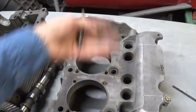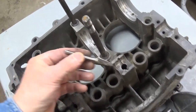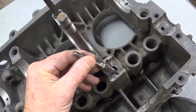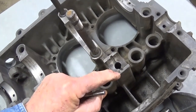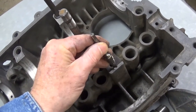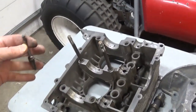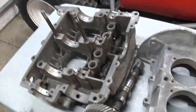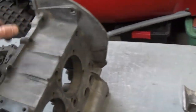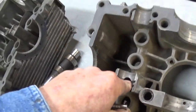As a matter of fact, if you don't drill the hole at all but you're running a bigger-than-stock oil pump with a high-performance cam, that groove widening may be something to think about. The tang for the cam bearings is right there and you don't want to get too close — you just have to be careful. These are the little tiny things that racers have figured out over the years to give them the edge. You'd also have to do it on the bottom side over here, because you're trying to get from that big hole to the other big hole with less resistance.